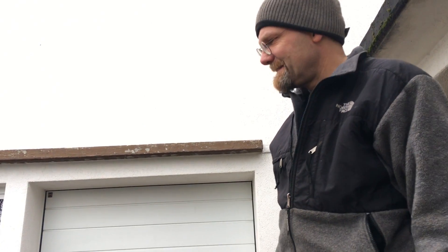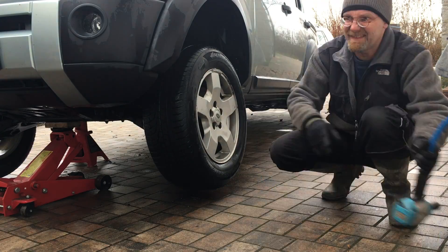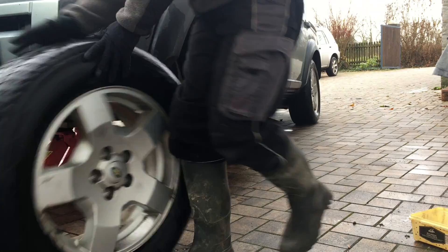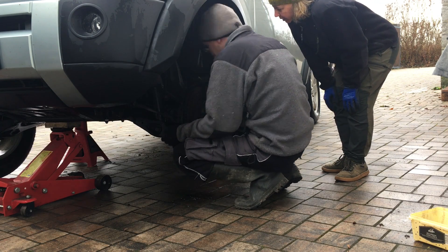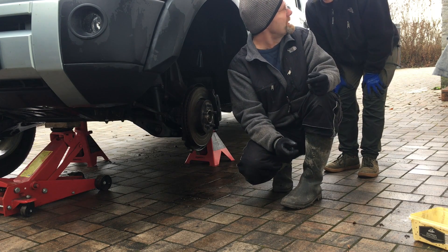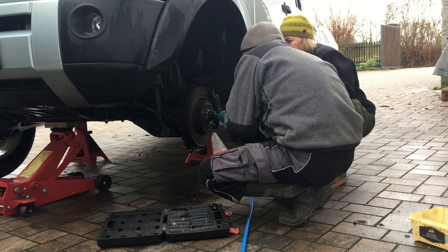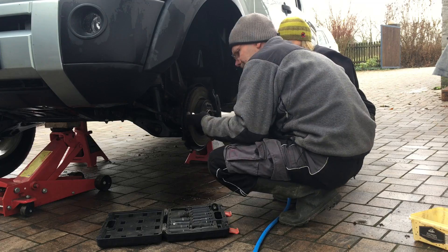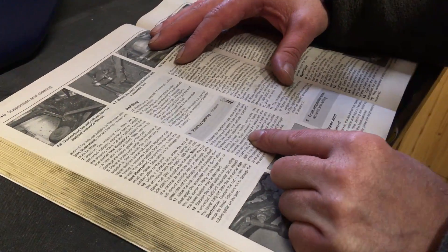We take the wheel off and then we look all surprised because we have no clue how to change a wheel bearing. I'm actually thinking about reading the instructions manual. I'm a little worried we're not gonna get this nut open... piece of cake. Okay — road wheel nuts, chisel or punch, unstake. Of course, we haven't done that — we haven't chiseled or punch-unstaked the nut, we just ran it out.